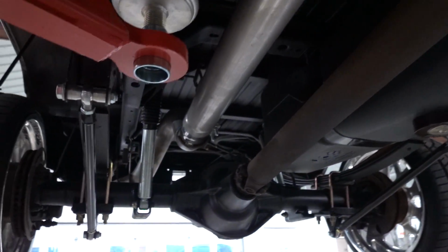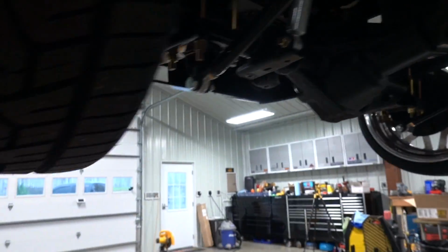So I'm gonna put this thing down on the ground, fire this thing up, and then we are pretty much ready to start idling this thing up, get the temp gun out, get it up to operating temperature, and go ahead and hot retorque the head so we can cross that off the list. After this video, whether there's a couple odds or ends or not, the next video that we will do with the second gen will be driving this beast.